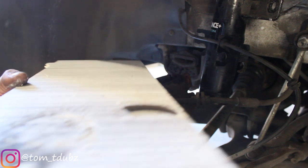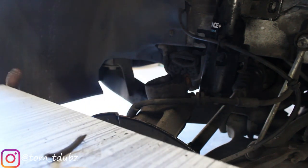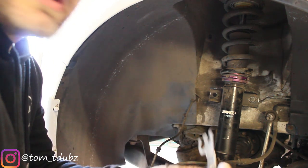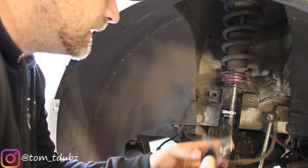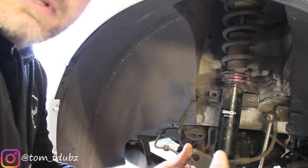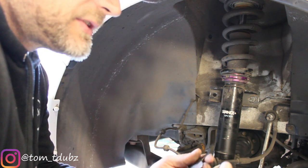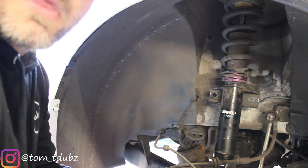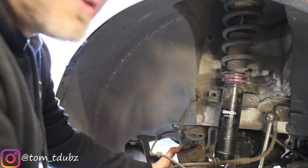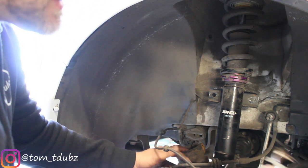Let me show you what you're trying to remove — that tiny little piece of metal that holds your strut in place. So what I've done before putting everything back together is I've removed this bit — this is basically the brake line hangers and the sensors for the brakes. I haven't done this purposely to go really, really low, I just want you guys to know that. But I've done it because I can then go lower. I'm going to get this in as low as it will go sensibly without getting anywhere near the CV boot of the drive shaft.